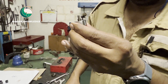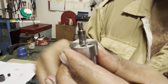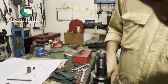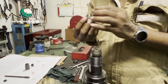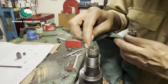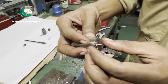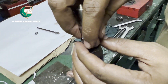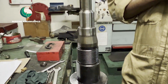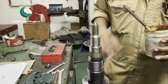Just take it out and drop it — the needle valve should go inside by itself. This is how you ensure the needle valve and nozzle are working properly. You cannot mix a needle valve with another nozzle because they are selectively combined. Also, this nozzle has a slot and the double pin should match. Now the nozzle is in place. Next, give a coat of moly coat or copper slip, whichever is available.